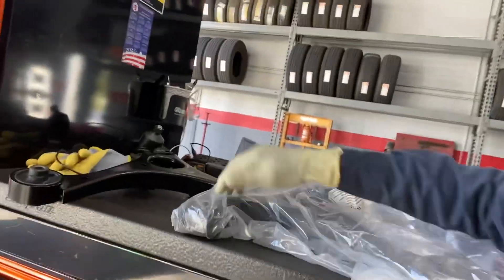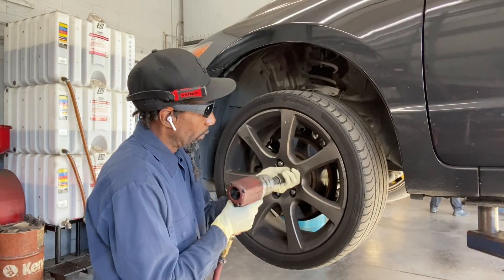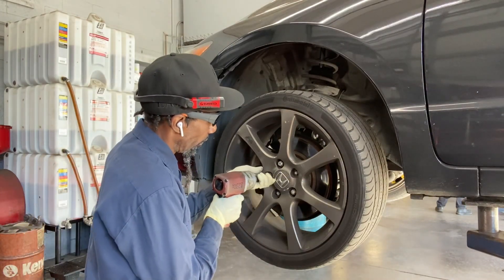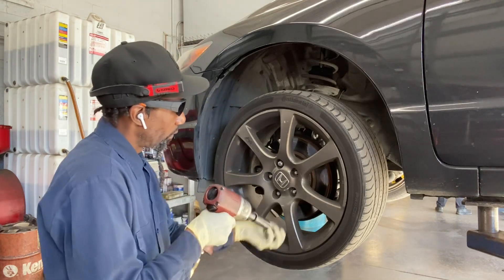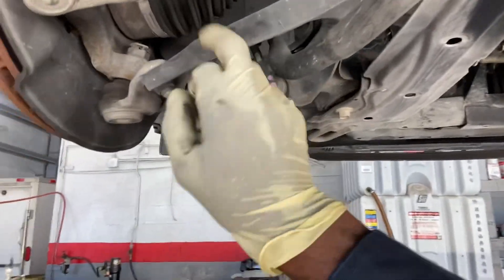Check this out. We're going to be doing lower control arm — left and right side control arm — complete assembly. This one here is a customer who brought his own control arm. I'm not responsible for the material; I'm only responsible for installation. Remember, I spoke about this to you a lot. So what we are doing is this: lower control arm, ball joint, inner bushings, one complete arm.